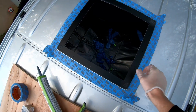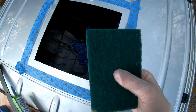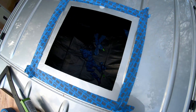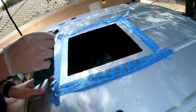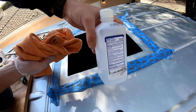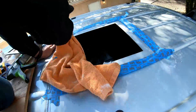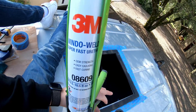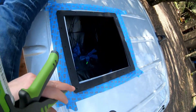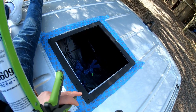So I've taped around the mounting bracket and placed it down so that I can go through and scuff the paint a little bit with a Scotch-Brite pad. This is so that the adhesive that mounts the bracket to the roof can stick better to the car. The instructions on the mounting bracket said to use 3M window weld — put a small bead around the outside of the bottom of the bracket, then stick it to the roof of the car and it seals pretty quick.